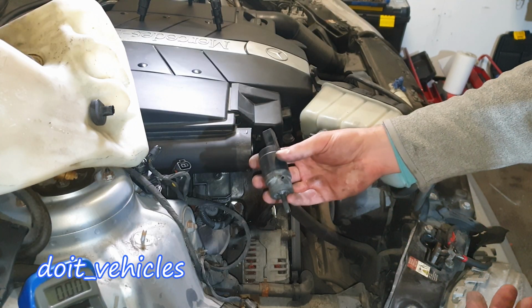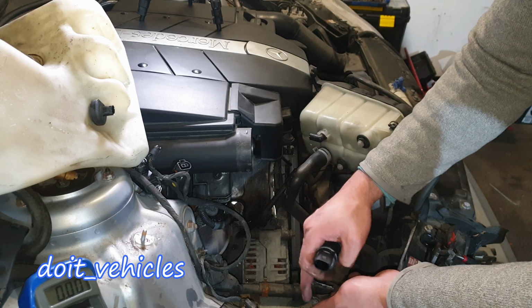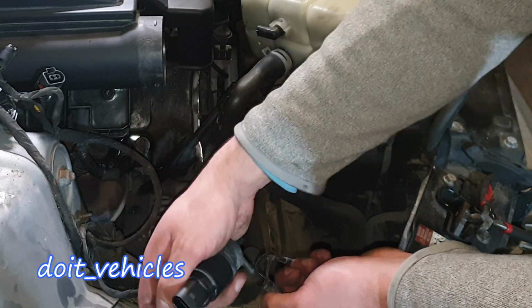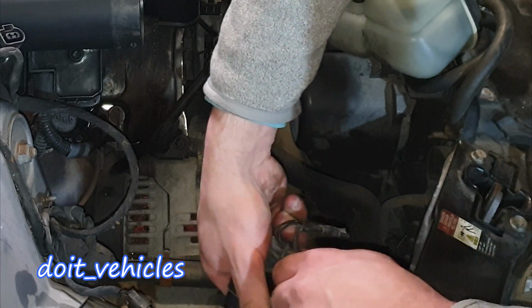Okay, so now it's time to install back the pump. First, it's a good idea to install it on this delivery hose. Make sure that you've got the right hose clamp. This has to be one of the smallest. Very possible that the leak is coming from here actually.